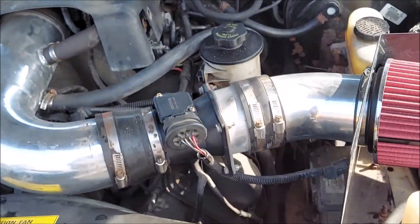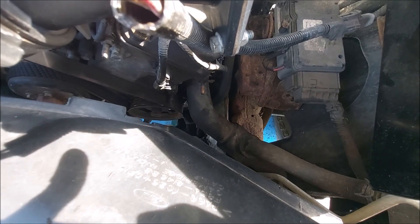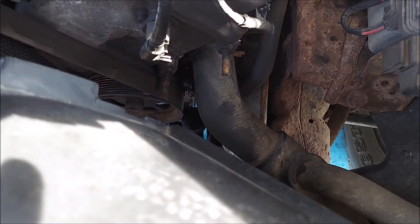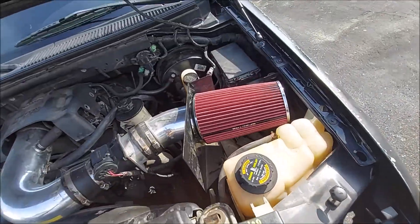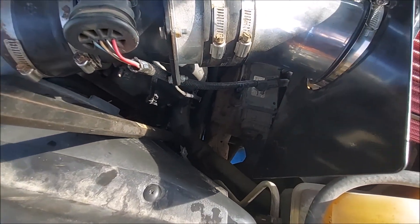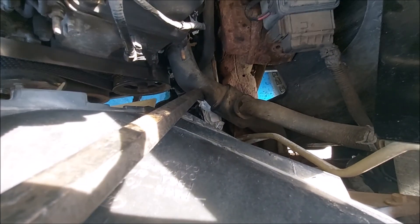I have this line right here by my finger. To remove the high-pressure line, there's that radiator hose and it's right behind the radiator hose. I use the crowbar to push the radiator hose out of the way a little bit so I can get to the line on the steering column.